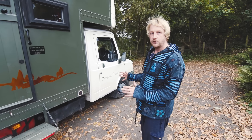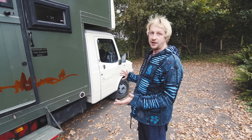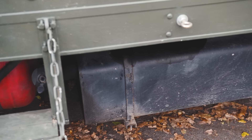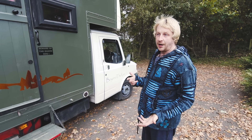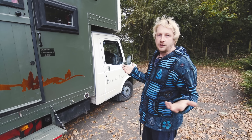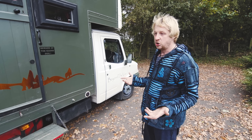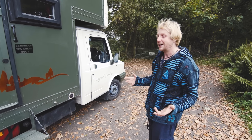Because of the size of the fuel tanks on this van — only 60 litres — and the size of the van, I've actually fitted two fuel tanks, twin tank, with one on each side. When you're abroad and take a wrong turn you can often find you've got 100 miles to drive before you find a petrol station, so the twin tanks really does help.